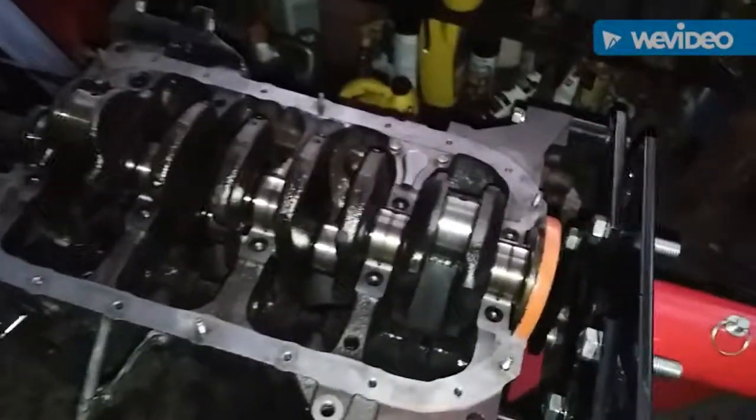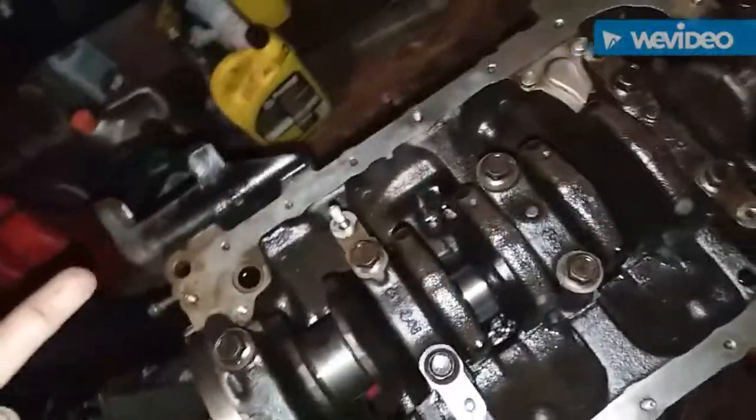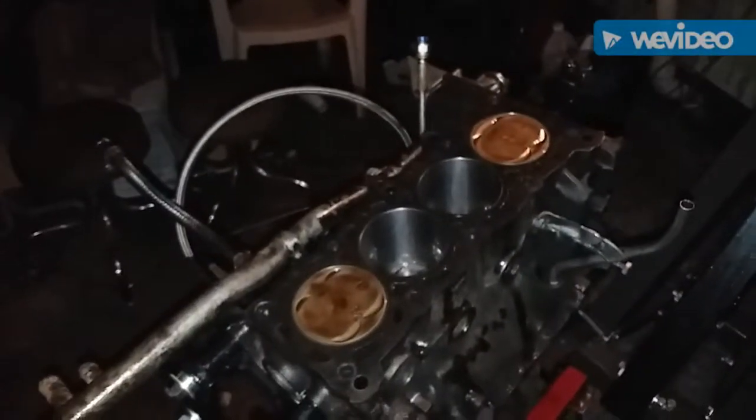Pretty much got both our seals in place. We got our mains torqued down — 48 foot-pounds is what my book says — crisscross pattern. We're going to put the rods and pistons in and then the oil feed tube. All the pistons are in, torqued down to spec. It's freezing cold out here so I had to put on my jumpsuit — we're going to call it good for tonight and continue the rest tomorrow. Stay tuned, thanks for watching.